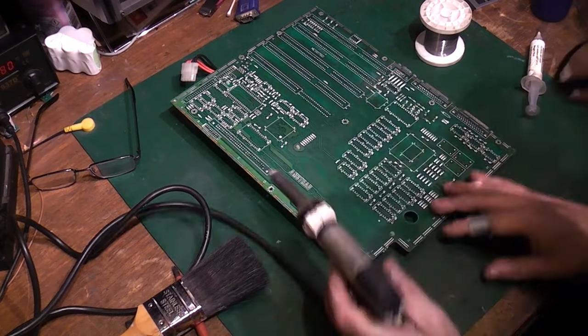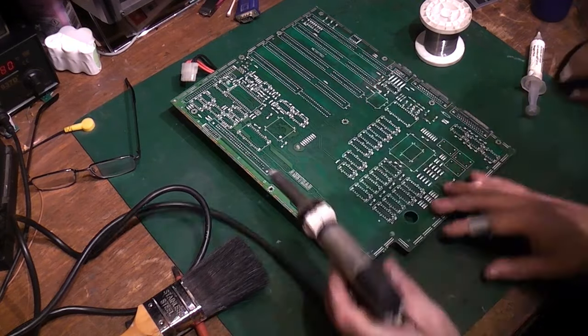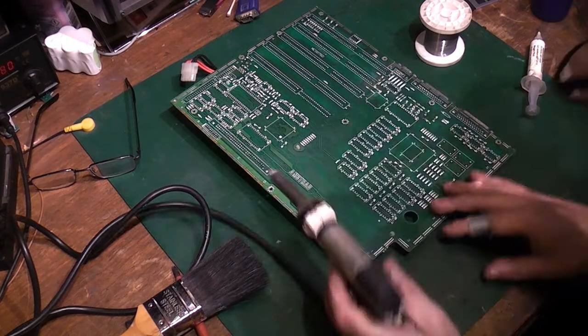I've got the old Packard Bell out connected to the Speedmaster. I'll use the chip test software — this is old MS-DOS software running under Windows 98 booted into the DOS environment. I go to the DRAM library, drop the chip into the Speedmaster, select the device — it's a 64Kx4-bit, which is 18 pins — and go to test device.